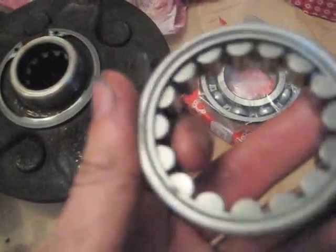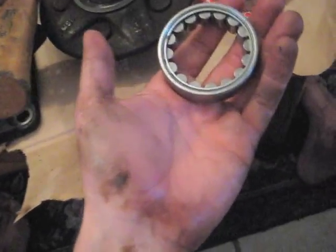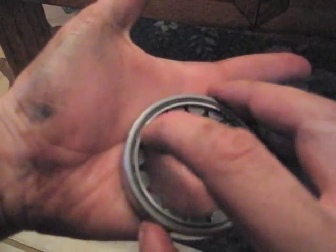I can't see very well. It's pretty hard to get grease in there, at least that's what I thought, and it's really not that tough. If you just do the normal way of putting some grease in your hand and then taking this thing and kind of like this, take some grease in your left hand and put a little thing there, and then take this side, just kind of smoosh it and take it away, and a little at a time, working your way over like that, and you'll see it eventually come up between this little tiny retaining ring and the outer race. You just keep kind of working across and work a little more into it.